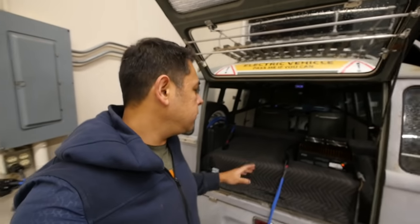I just finished installing my DIY heater, but the problem is I'm getting some strange smell - like burnt plastic. Three years ago when I put this thing together, in all my wisdom I glued the heating element to a plastic fan using epoxy. I ran it on the bench for 20 minutes and it was fine, but now that it's in the car there's a smell - and I'm worried it's melting the plastic. That's a huge problem because that heating element is powered by a high-voltage pack, and if it falls and touches the casing, you'd have a connection to either the high or low side of the high-voltage pack on the vehicle's frame, which is bad news.